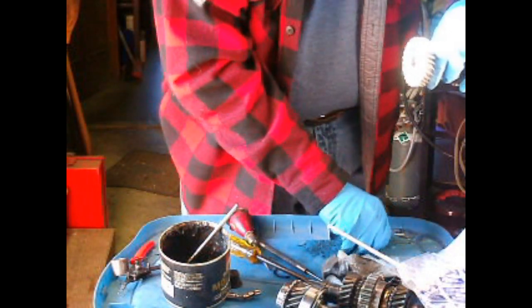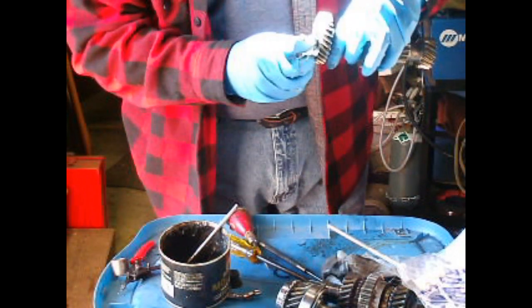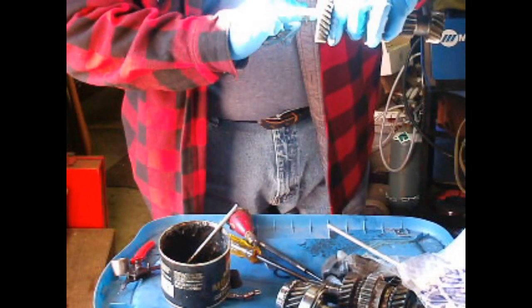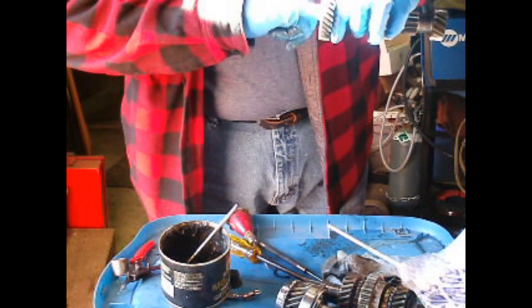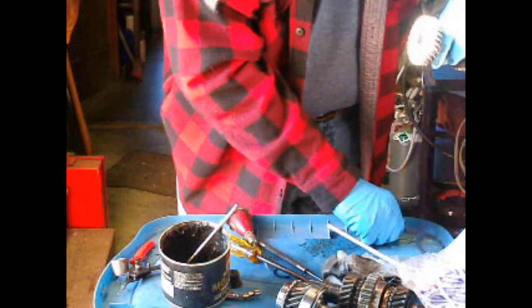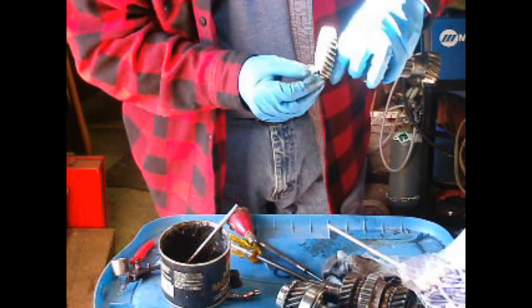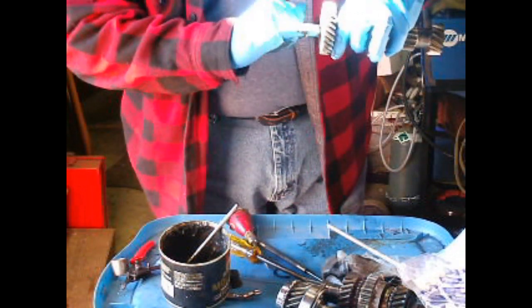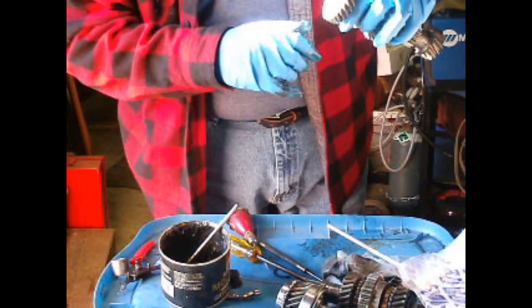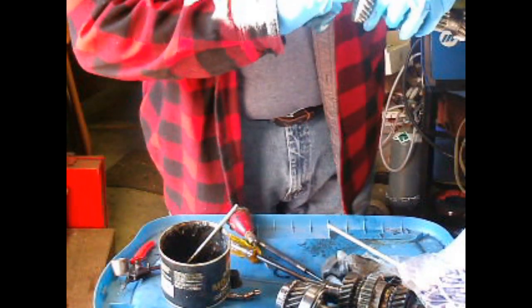So with a modern bearing, which would be a way to reuse that gear cluster, you could have turned it out so it would accept the bearings in the race, but it only has about half the capacity because there's so many fewer bearings, and they don't really make a solid filled one, unfortunately. So it's getting harder and harder to find these, because this is the piece that breaks on these transmissions.